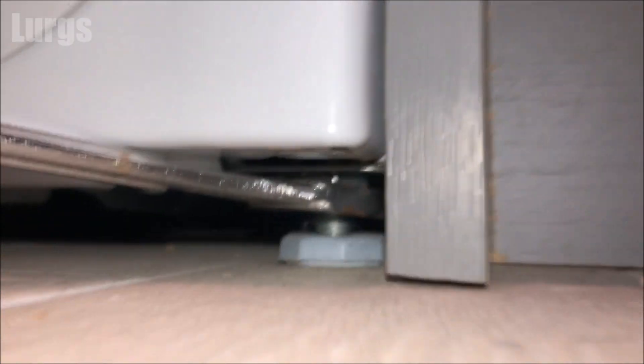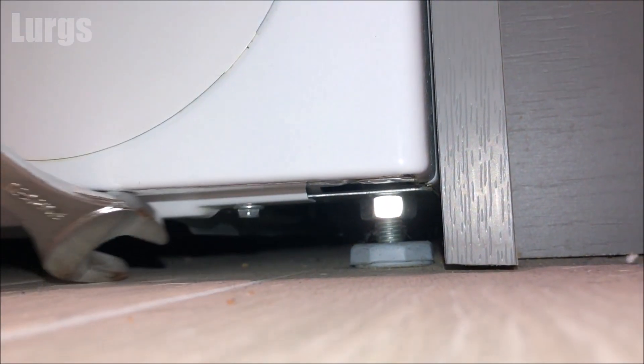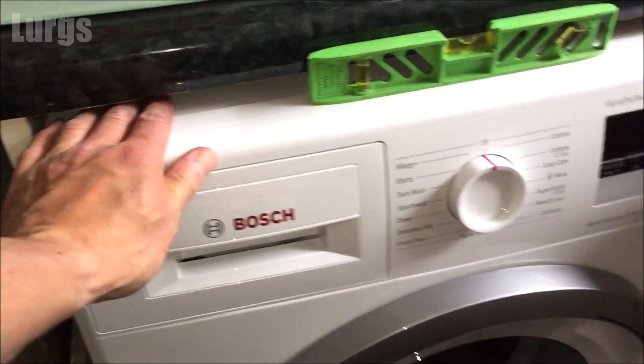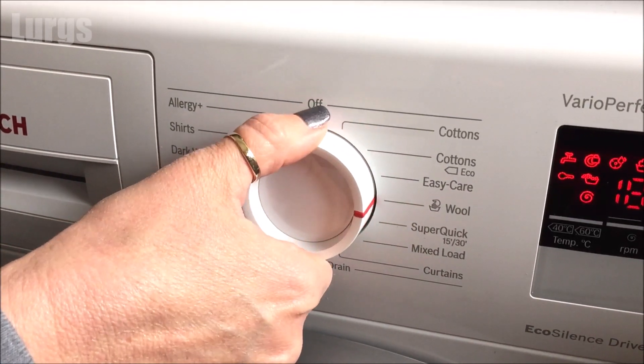Make sure you do it on the other side too. The washing machine is now nice and level. If you haven't got a spirit level you can use a marble. The machine is now locked into position — let's just check it with the spirit level again. That's looking pretty good. Just take your hand and push it on either side — this one isn't moving at all. If it's not level it will make a horrendous noise when it's doing the spin cycle.